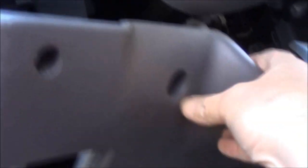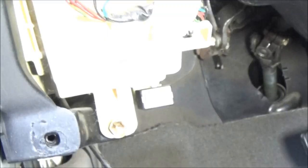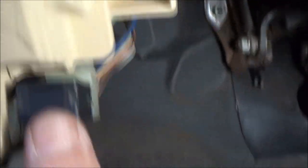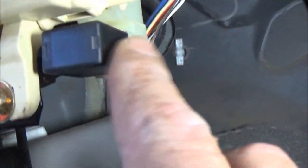Pull your kick panel off — it goes up under there. It's self-explanatory, just take your screws and bolts out and it'll come right out. Now on this one, some of them are mounted right up in here, but you may have to look for it. On this 2003 Tacoma, the 2.4 four-cylinder, it's right here — that is it right there — and it just pulls out.